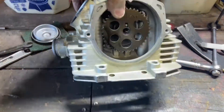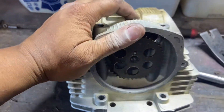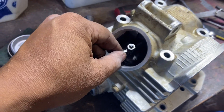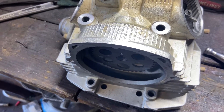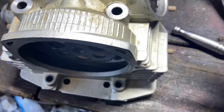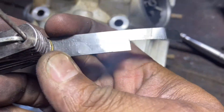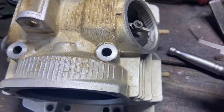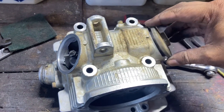We officially have this head work done — just changing those valves. We put the gear back on and measured the cam right up and down with the point being equal to top dead center. We took a 10 millimeter to loosen these nuts up and used needle nose to hold on to these — a little bit of wiggle does not mean they're bad. Both valves, exhaust and intake, spec is 0.1 mm — exhaust can be up to 0.15 but we're using 0.1. The feeler gauge just barely goes in there with some resistance, and it does have that drag. Same thing on the exhaust — a little resistance — so we're good. We're going to go ahead and put the caps back on and this head is complete.